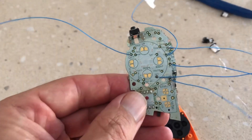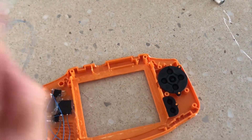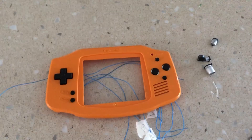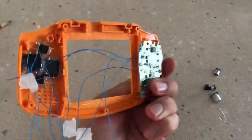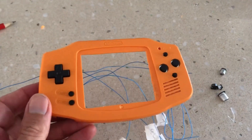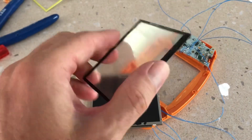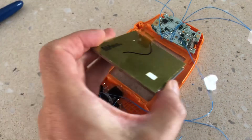To make life easier, we used all the original soldering points on the Game Boy Advance directional pad, as well as creating a section for the earth wire. This would ensure that the feel of the directional pad was as close to original as possible. To make future work easier, we then went about labelling all the wiring for future soldering to the original DSi board. Our next task was to ensure that the LCD screen was clean for fitment. We went about removing the original touchscreen panel, cleaning it, and then assembling it again before installing it into the Game Boy Advance shell.